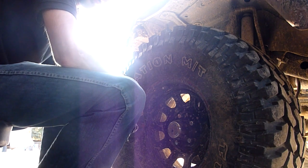There you go. Take it for a little test drive, make sure everything works okay. After a couple hours of driving around, torque them up again. It's going to depend on how you're driving. If you're going to beat it around off-road for half an hour, check them in half an hour. On the highway, check them in three or four hours. Driving around town, you're good for a day or two, then torque them back up. Less than 15 minutes and you've changed or inspected your brakes. Really simple to do with basic hand tools — if you can do the wash by yourself, you can change your brake pads.